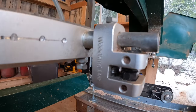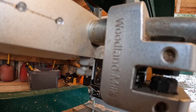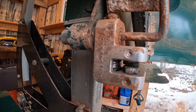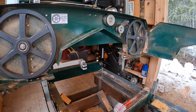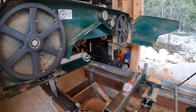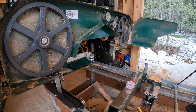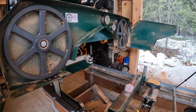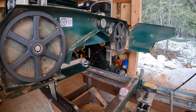There is a bearing right there and it definitely has a groove in it from where that saw blade has been riding. That one has the same groove there. I have an extra set of these. The sawmill has been running good. Maybe I'll defer to some other guys that have run mills longer - at what point do you change those bearings out? I think I'm going to run with it. I'll check the spacing once I put a new saw blade in and make sure I can move those forward to close any gap. My guess is that the saw blade is running in that groove, and that's probably not an odd thing - that's probably where it needs to be. But let me know what you guys think.